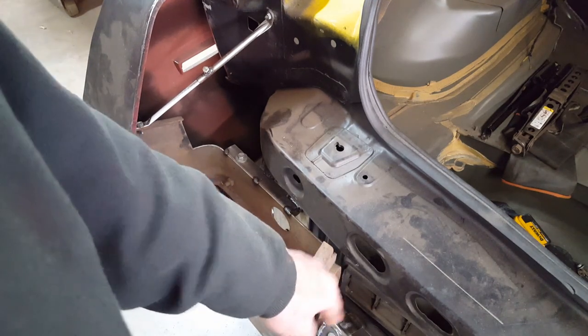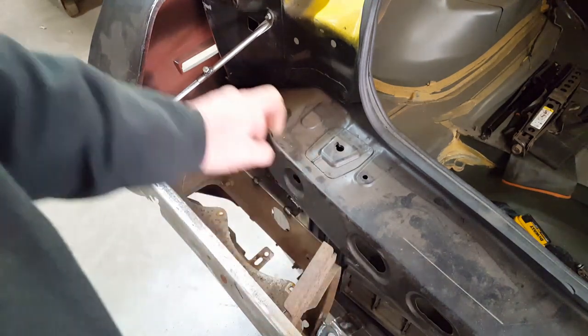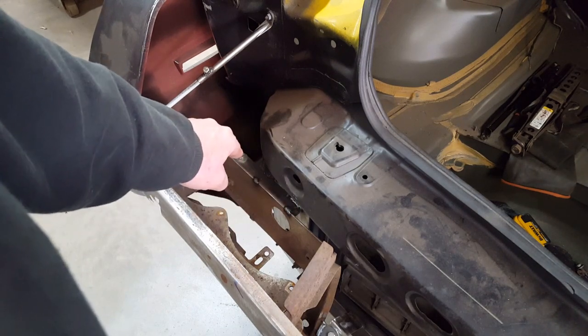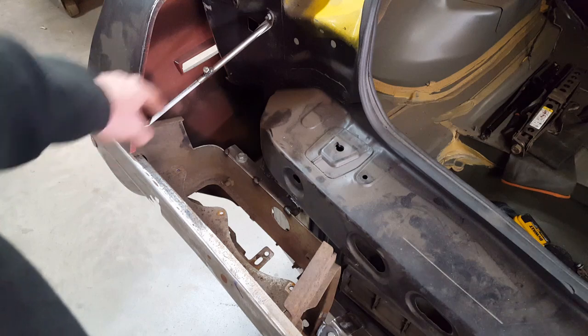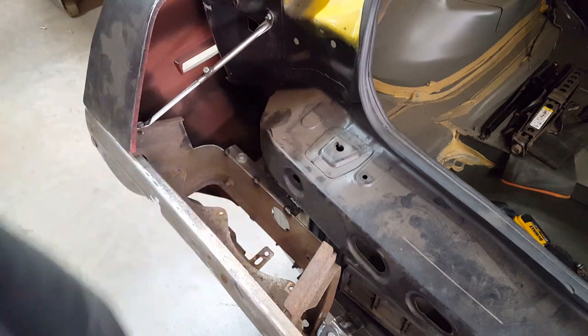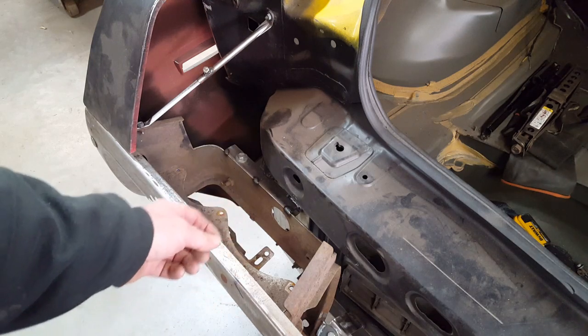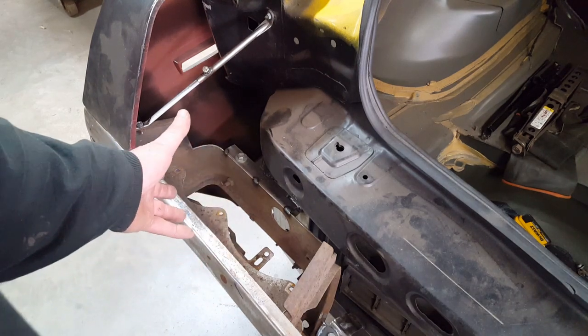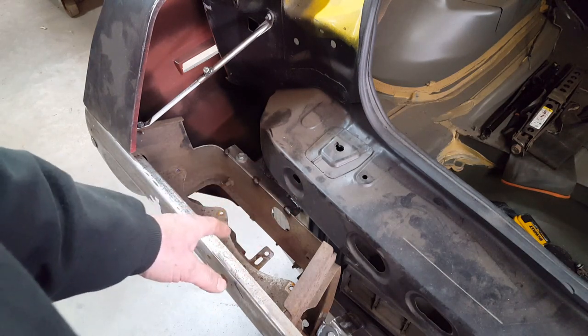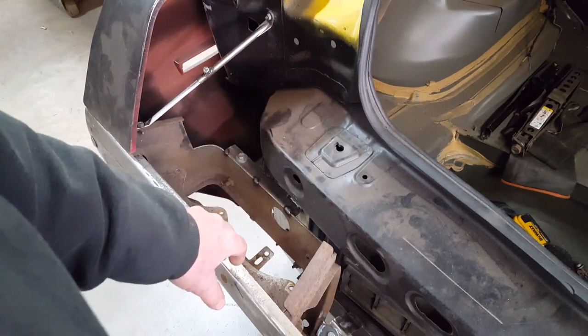So it's just one tab on each side, that tab down low on each side, this flat flange over here sitting on top of the 1 inch tube, and this diagonal that holds everything and keeps it from rotating, and that's pretty stable. Now I'm able to take the bumper straight off the car once the roll pan is in, and I won't have to worry about reaching in and around any of this structure.